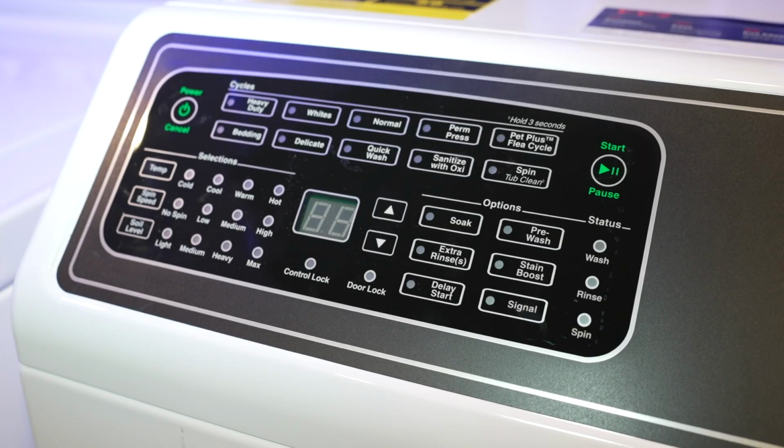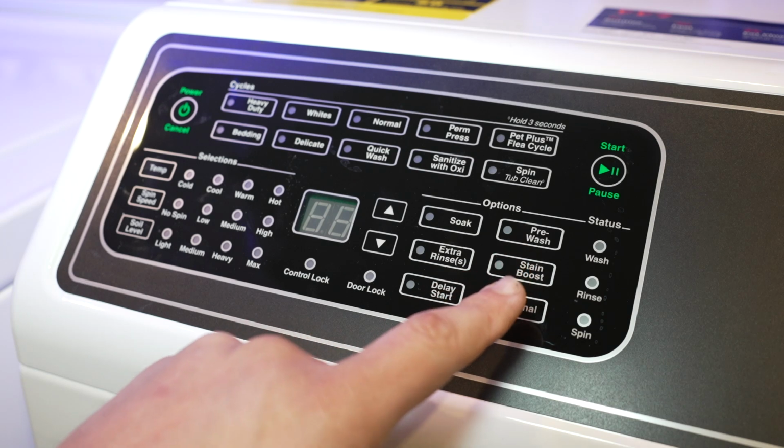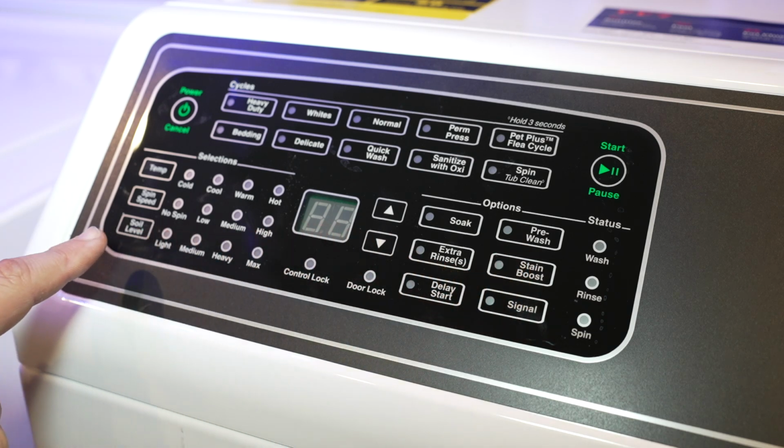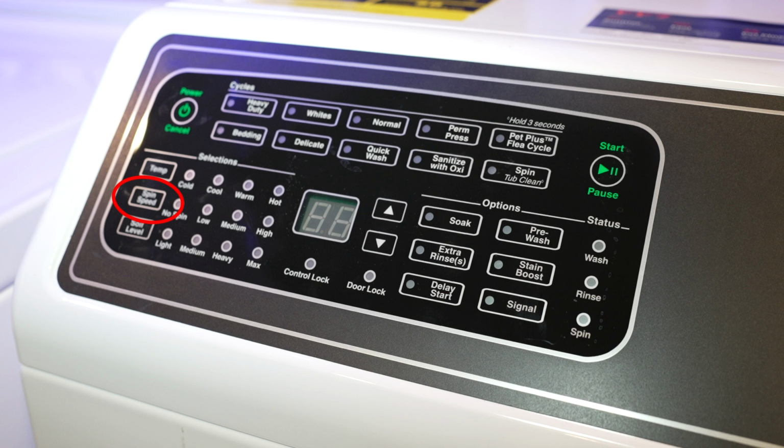If you did flip the dip switch number 3 on, you would want to go back to the front of the washing machine, plug it in, and then use key number 8 and 14 to enter the extra water mode. From here, you would press button number 3 to increase the water level on the LED screen.